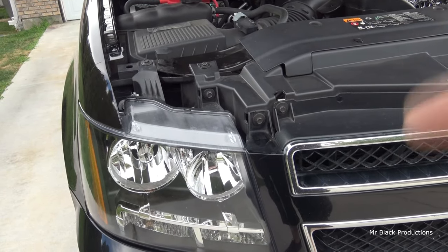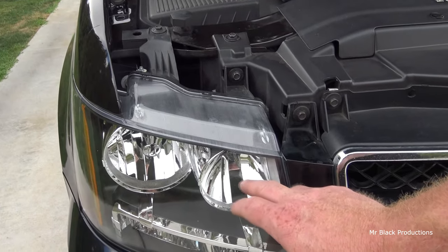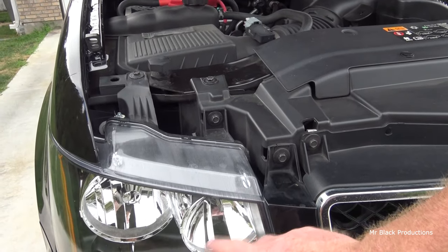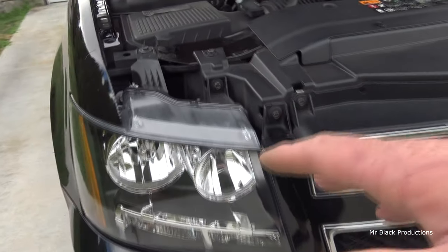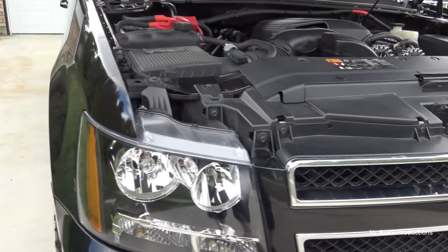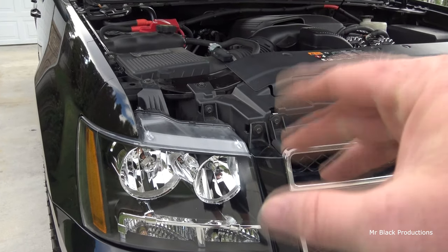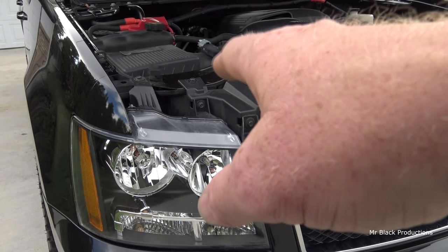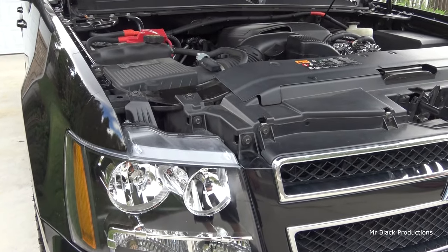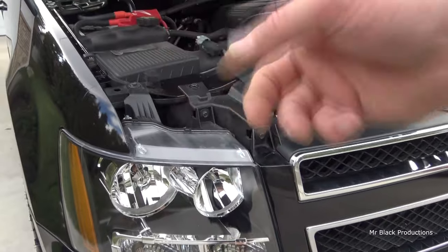But the main thing I was looking after was noise. Usually the LED drivers in this style of headlight will create so much noise in your receive from the headlights being on, you end up having problems. Well, with the highest quality LED light that I could get, there's no driver noise. But the problem is the RF from the antenna was causing the high beams to click on and off as if they were pulse modulating, because it's screwing with the light driver inside the LED. So how I got around that is I took 2 pieces of ferrite, and on the harness that comes off the light, I wrapped the lights in the ferrite, both sides.